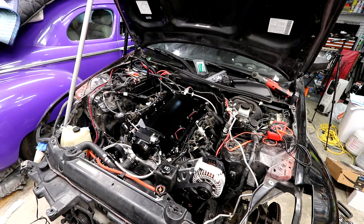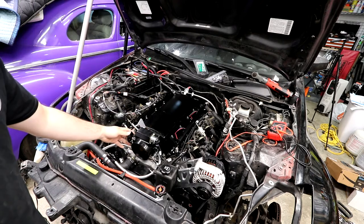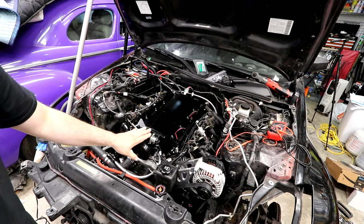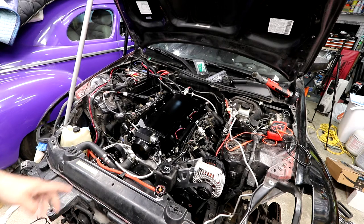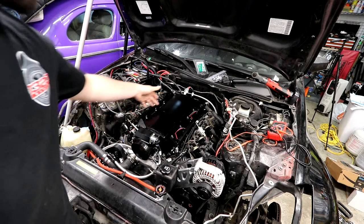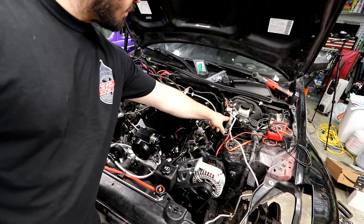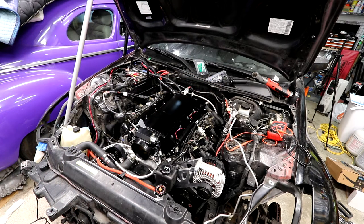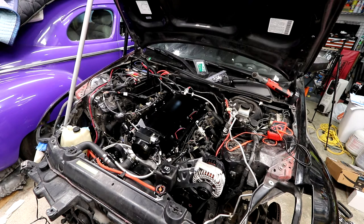Getting into the car business — you can see we have the throttle body right here, which is drive-by-cable. What I've seen guys do is just take the cable, and with all the mounting hardware, basically run it through a cutout that enters the cabin of the car under the brake booster. I'm going to get my head under there, pull the pedal out so we can make our modifications out of the car, and we'll start there and see where it takes us.